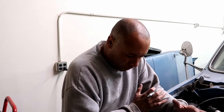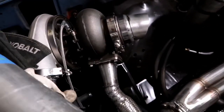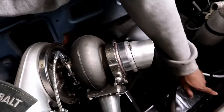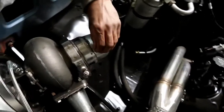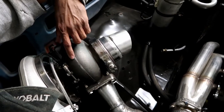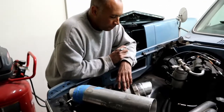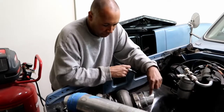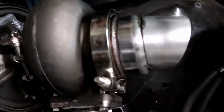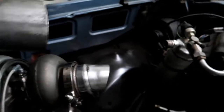What's up guys, here is the next series on this build — it's going to be the exhaust. I'm going to run the exhaust from here, going between the headers down the frame rails and out underneath the truck on the passenger side. This pipe is three and a half inch, about as big as we can get to still clear everything. We're going to do this with pie cuts instead of waiting a week to order bends. I've got this part welded on already — don't mind the welds — and we have two more pie cuts right here.